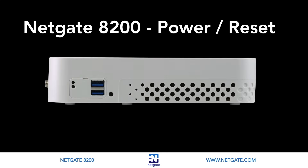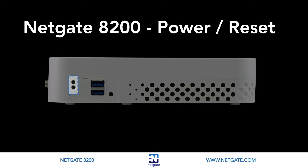There are also two recessed push buttons next to the USB ports. One is for power and the other is for resetting the system — the power button is on the bottom and the reset button is on the top. A short power button press triggers a graceful system shutdown or brings the unit back up from an off state without physically detaching the power cable. Users can also trigger a hard power cut by holding the power button down. The reset button is used to reset the unit to factory default settings and is more deeply recessed than the power button to prevent mix-ups. You'll need a small object like a paperclip or pen to press it.